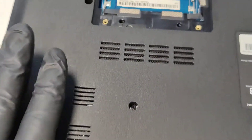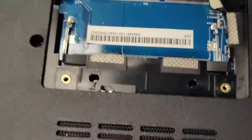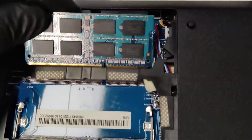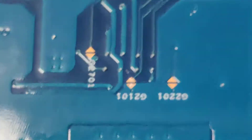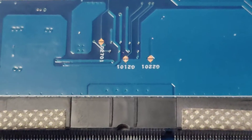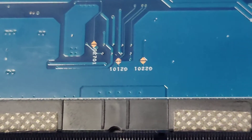What I ended up having to do involves this little point underneath the RAM slot cover. You just pull back these two clips — there are two screws to take the cover off. Down here is the contact point for the CMOS battery.